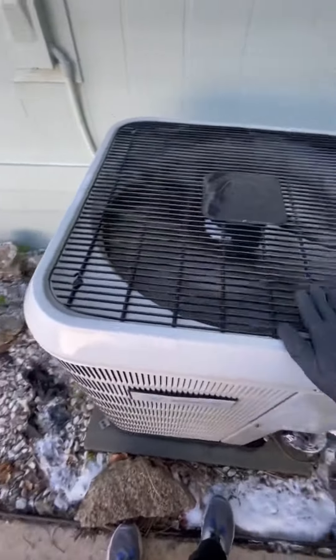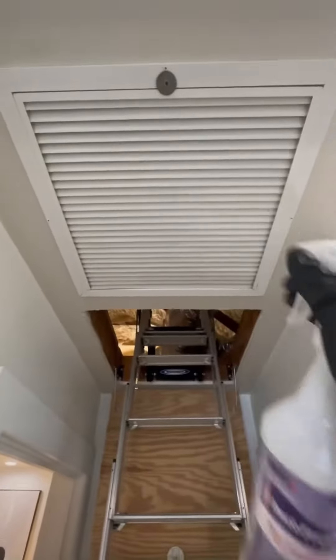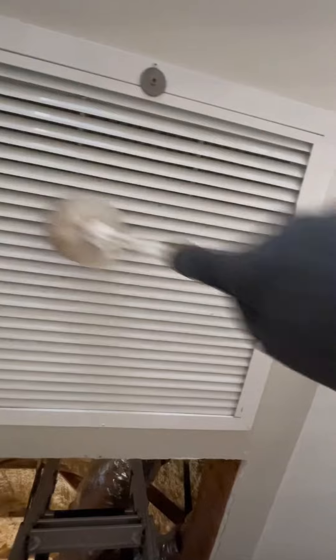Got everything up and running — looking good. Most importantly, the filter rack. I like to clean that, wipe everything, get the dust bunnies off of it, clean it with the towel, and change the filter. And we are all set — pretty good little air conditioner right there.